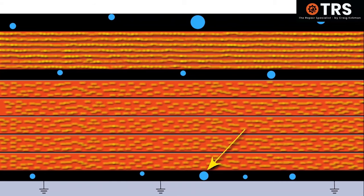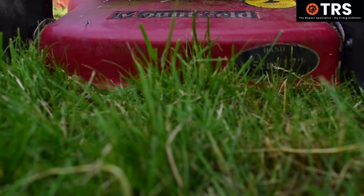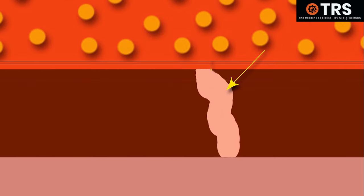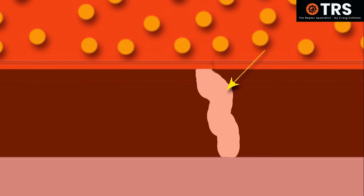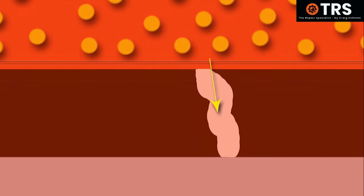Let's look again at why an engine will start and then after a little while stop. If there are slight cracks in the insulation — not big enough to let electricity through when cold — then when the coil warms up, the expanding components open up that gap and electricity can short through, causing the engine to stop. When the coil cools down, that crack comes back together again, preventing the shorting across, so the engine will start again. Until, of course, it gets warm again and then it stops.